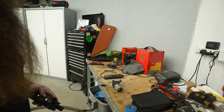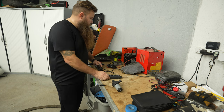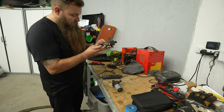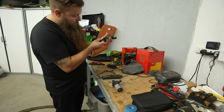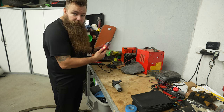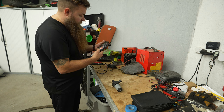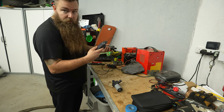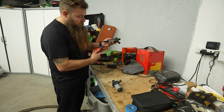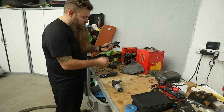This is the tool I was talking about — it's called a Power Probe. Great bit of kit. You connect it to a battery with crocodile clips and it gives you a 12-volt supply. If we take this original pump, on the plug it says negative and positive. You put that onto the negative, press the on button, and it will give you whatever voltage you have on the battery — so 12.5 volts here. Just touch it onto the other pin and listen — nothing. So that pump is absolutely dead.